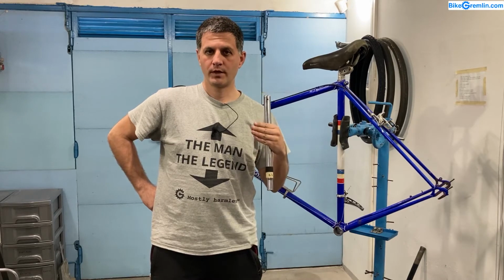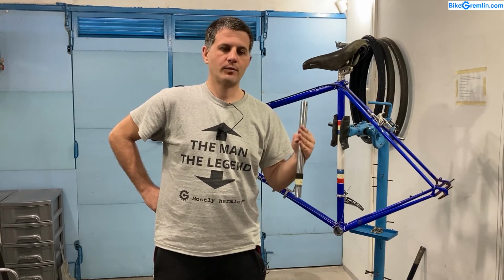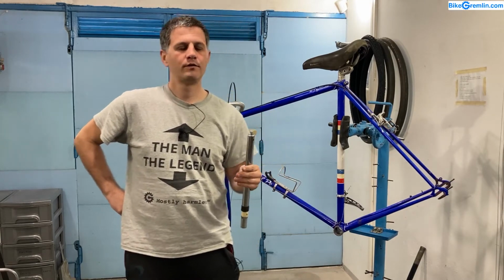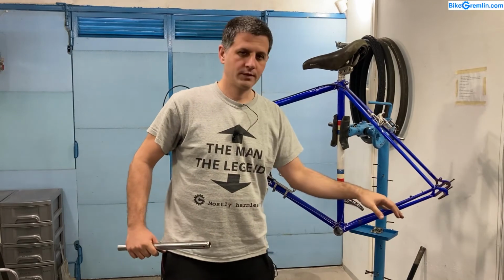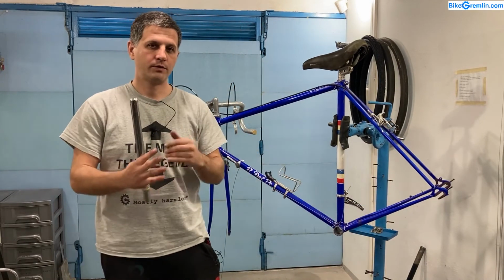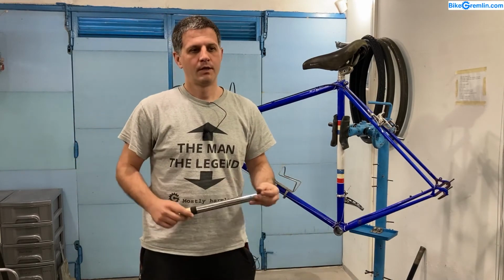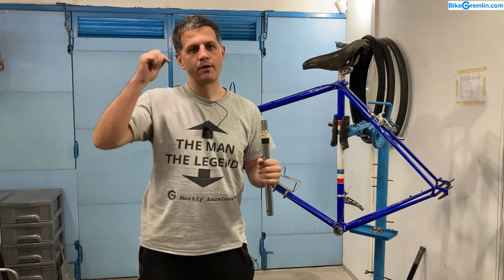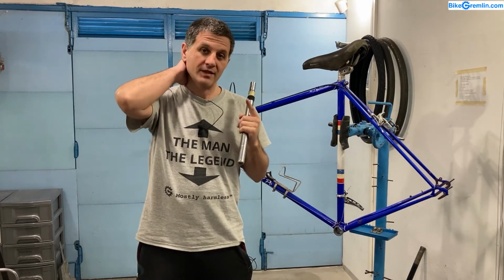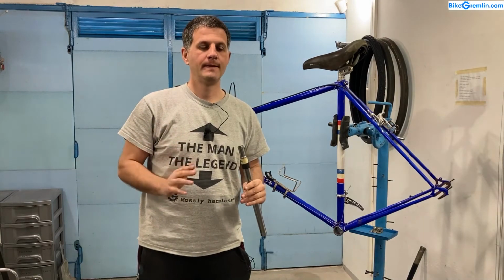So even when you're buying a new frame, it might be a good idea to scan it, and perhaps even once a year if you ride a lot, or if you have some paint damage, or if there are any metal parts in the frame, so there's galvanic corrosion between carbon fiber and aluminium usually, or steel parts. So that adds costs, and there is that risk. So for heavy riders, for that reason, I might not recommend carbon fiber bicycles as a good idea.